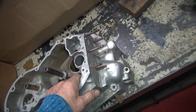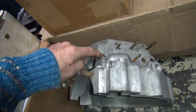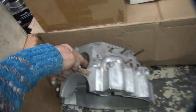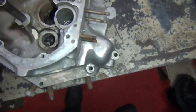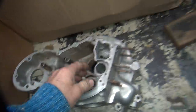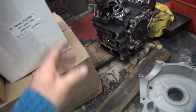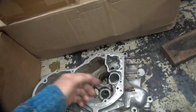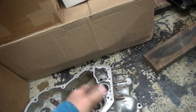The other thing that's very important on a Harley is you have to make sure your vent, which comes out of here - on real Harley motors there's a vent tube on every motor right here. This goes up to your oil tank which is up here someplace. That equalizes the pressure between the gear case cover because the hole goes right through the case. The pressure in here and the oil tank is the same, so that means the oil tank will have equal pressure so the oil will gravity-feed back down to your pump - so you don't run out of oil. It also means when the oil goes back from the pump up to the tank, it's not under positive pressure going up to the tank either.